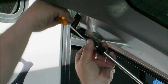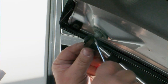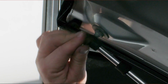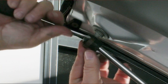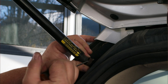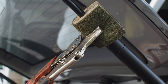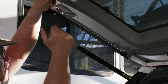Now using the screwdriver, remove the clip from one end of strut two. This will take a little prying on each side of that clip to fully remove it. It might be possible to only partially remove this clip and still be able to remove the strut end, but I find it better to have nothing holding the part on when I try to remove it. Then repeat this process by removing the clip on the other end of strut two. With both clips removed, make sure the locking pliers are still in place on strut one. Then tap the end of strut two to pop it loose from the ball mount.